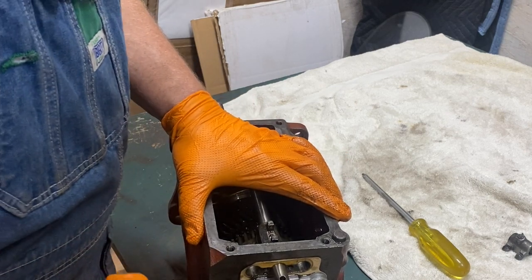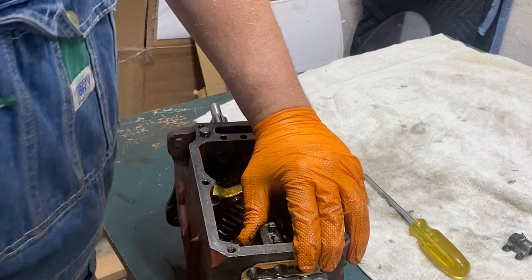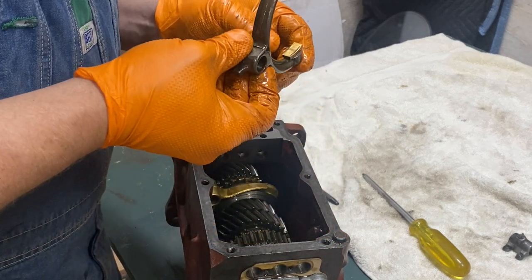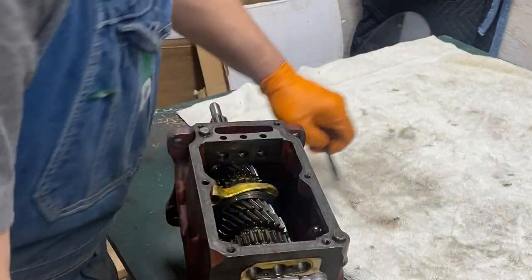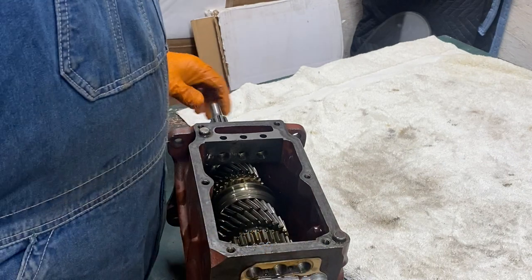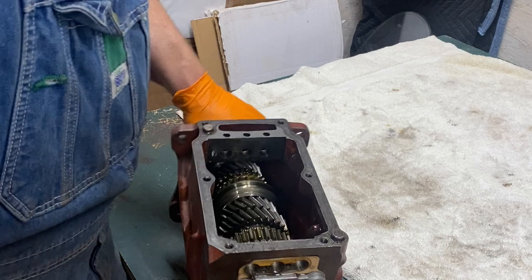These bits have been in there so long and my hands are already oily. I gave myself a little help with a pair of channel locks — I did not score the end of the selector pin, just got a little more connection than I could with my fingers. Checking the feet on this selector — that's the first-second and they look pretty good, not worn out too much, not beyond anything they need to be. And here's the third-fourth selector — it's all good. Bunch of relief. Got those out. That took forever to get that grub bolt out of there. It was a mess.